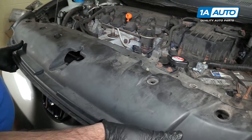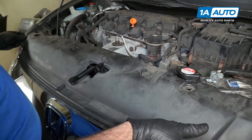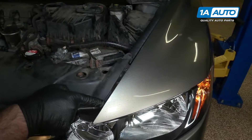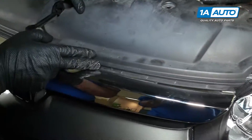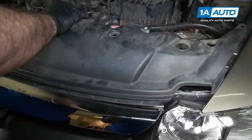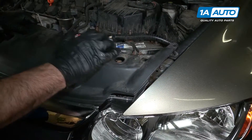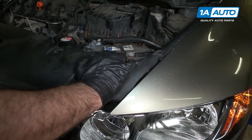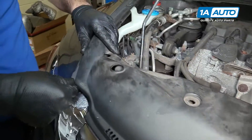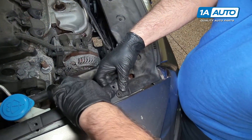I'm going to reinstall this air guide. It's kind of flexible, so I'm just going to slide it up and over, and you're going to fit it over these little rubber bump stops. These tabs actually go underneath the fender, and then this lip goes behind the grille. I'm going to kind of flex it into place, just like that. Then you can bend this up and slide this over, fold this up like that. Do the same for the other side — kind of flip this in, push it in, put this over, put this under the plastic trim.